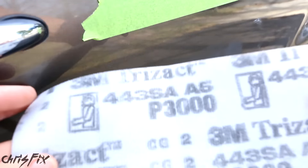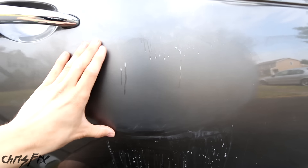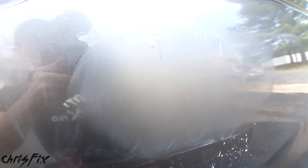Let's spray down the area and clean it off to inspect our work. This is coming out beautifully. We can take the tape off because now we can see our area, and the scratch is completely gone — there is no mark at all where that scratch used to be. Now we have this hazy area that we need to polish so it looks like the rest of our paint. If your scratch is still there, keep going with the 5,000 grit. At this point you don't want to see any scratch, because if you do, you'll be able to see it when you're done.